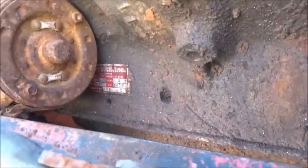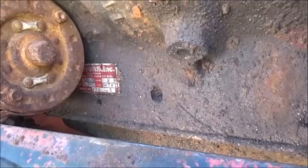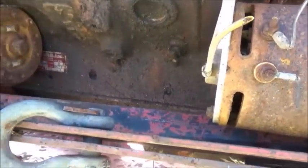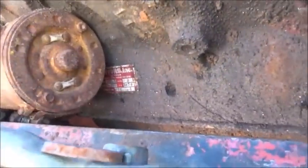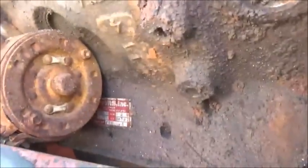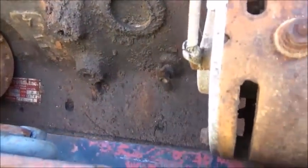That's about the limit. So it's definitely been rebuilt, and that tells me right there that the crank is not going to be good for turning again. So if the crank's bad, it would need one. And I can't see all of it up under there to tell what the bore and the rods are, but let me see. That's the thing about getting old, you can't see a darn thing. Let me look, hold on just a minute. Okay, so it's bored 30, the rods are 30, and the mains are 30, which is a long way to go with rods and mains.